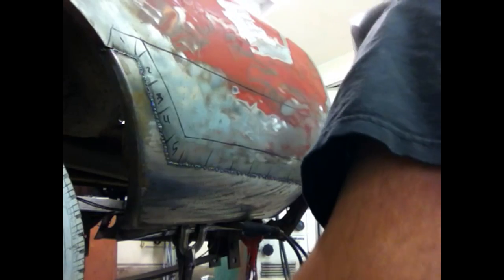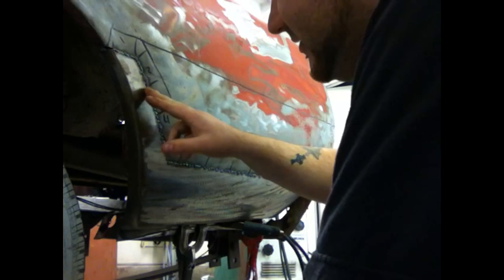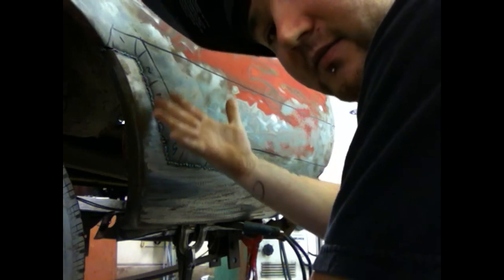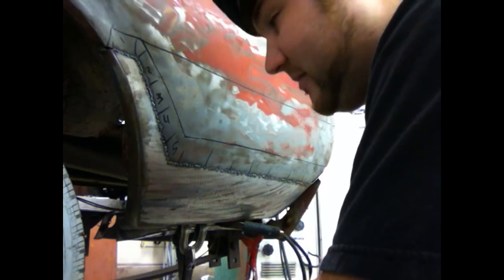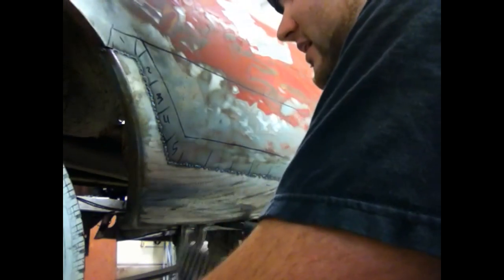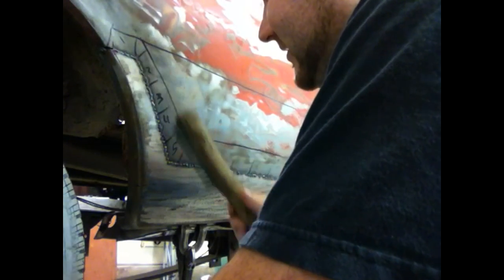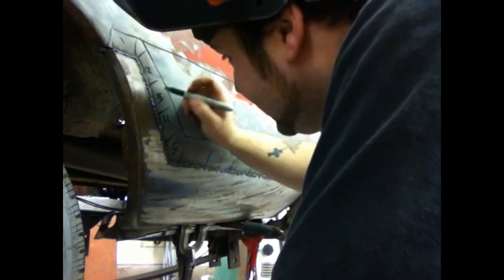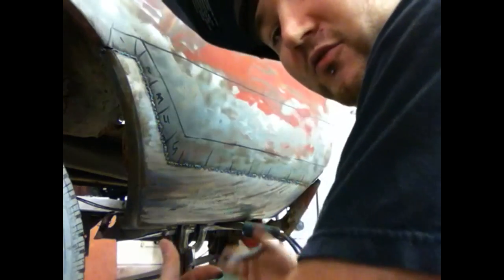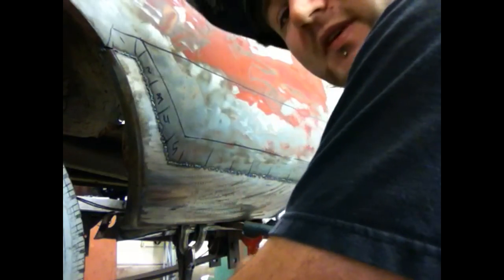You're going to want to keep your welds clean because if you keep them all dirty you won't know where the weld is — and sometimes you'll actually leave a little pinhole that can come back and bite you after you get your bondo and paint on. Make sure everything is nice and sealed up, go over it a few times, and you'll find your little spots — like there's a tiny one right there you never would have seen before because it was too dirty from the flash of the weld.